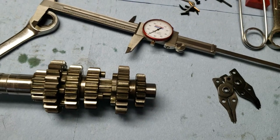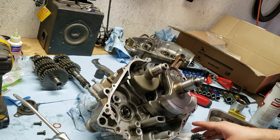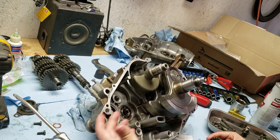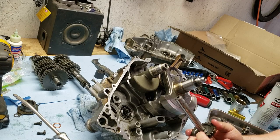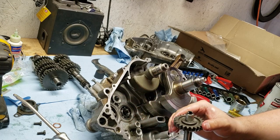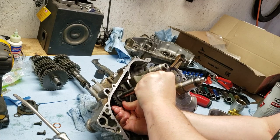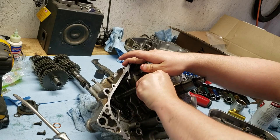I'm going to go ahead and get the case cleaned up and start putting these gears in. Now it's time to start putting the transmission back together inside the case. I've got all the seals replaced on the other side of this case and all the bearings are lubed up and ready to go. Starting off, I'm going to go ahead and put in the counter axle. There is an orientation that it needs to go because of the shaft design inside the case, so just make sure you line that up. The gear should be able to move freely but the shaft should not.